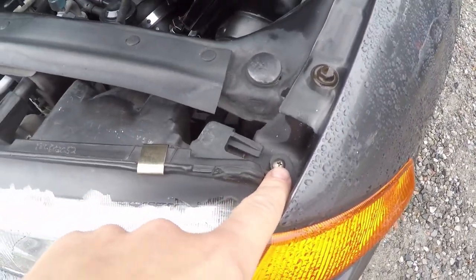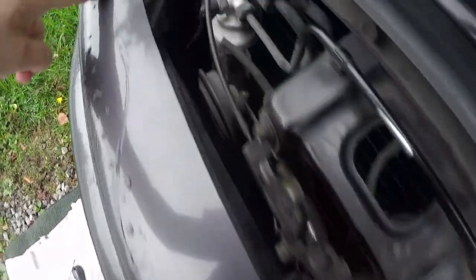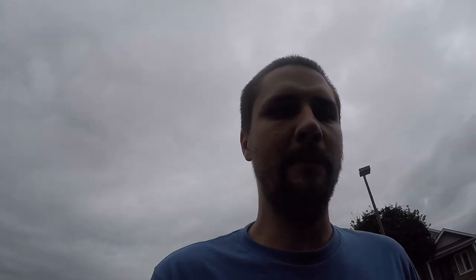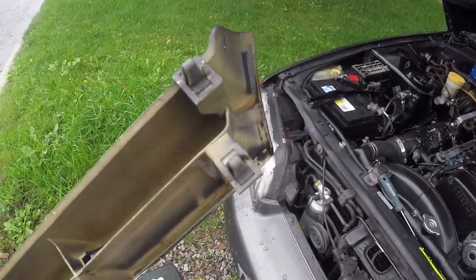All you technically need to do is remove the bolt on each side, pull the headlight — there's a screw underneath to remove. This piece is separate from the bumper and attached by two clips that you simply push in. Then you have screws up top, screws along the bottom, and three screws right there. Once they're all removed, you pull the bumper.